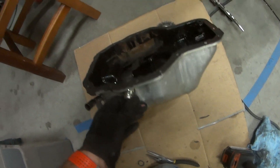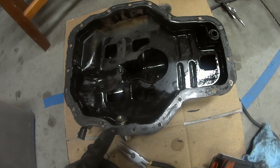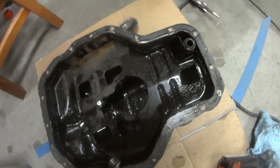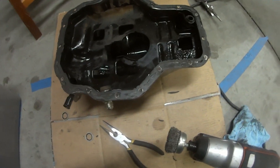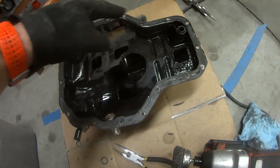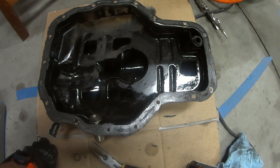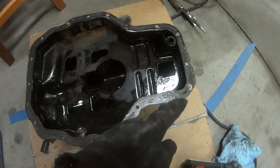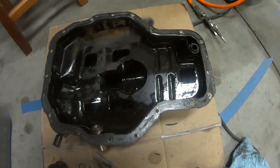This is the mess I'm currently in. I've flushed a lot of the metal bits out of the pan from drilling the hole, but there are probably still a few in there so I'll flush it again. Then I'll take my wire wheel and get all of the RTV off that I put on in a previous episode. Once that's done, I'll follow the fluid packing technique in the service manual and delicately reinstall the oil pan — probably starting with the easy-to-reach bolts before doing the three tough ones in the back. I'll leave the engine jacked up for now. If you're putting an oil pan return for your turbos in an SVX EG33, this should help you out.